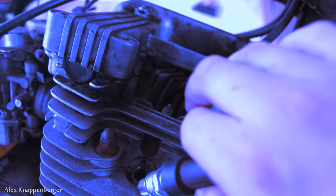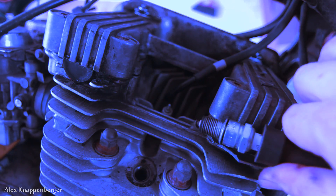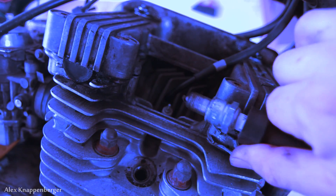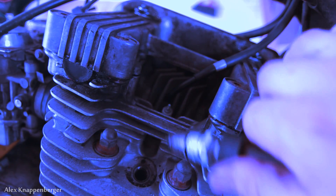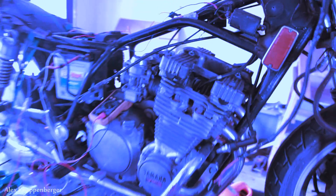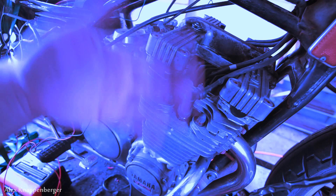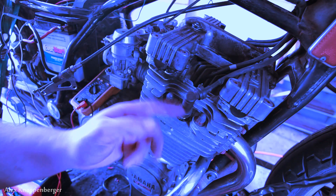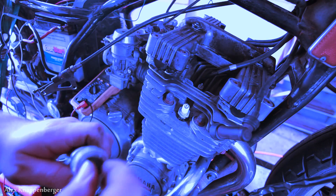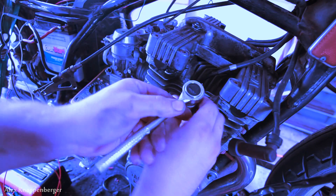On all these motorcycles too, if we're talking about motorcycles, they have all kinds of switches that will disable the spark and turn off the ignition. This bike in particular — looking at here — is a 1981 XJ750. It had a side stand switch for the kickstand, has a neutral switch, has a clutch switch, and even has a switch that shuts it off if it tips over — which could also be faulty. So some of these bikes, especially from the 80s and even today, have all kinds of safety switches that will disable ignition. You really want to look at that type of stuff if you're fixing a motorcycle. Hopefully that can help a little bit.